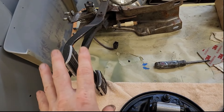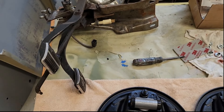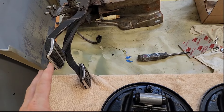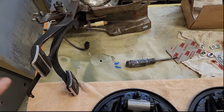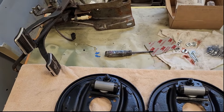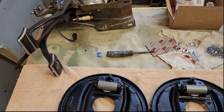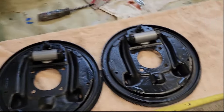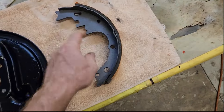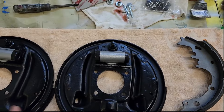After I'm done doing these, I'm going to go after the clutch pedal and brake assembly. I'm going to restore this whole thing right back to what it used to be. Of course it's never been out of the car — Dave took it out and he's been fully restoring the body shell on it right now. He's got the quarter panels done, trunk floor done, floor pan done. The car is just coming out amazing. So when it gets down here we won't have to do much metal work, but we're going to have it on the rotisserie and fine line go through everything. The brake shoes are all cleaned up, the lining's good, and we have them all taped up temporarily.